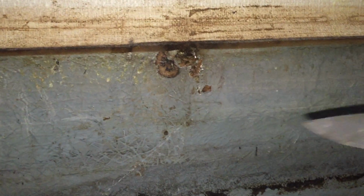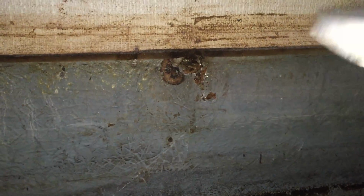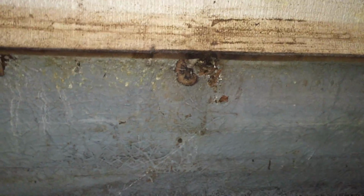right underneath the screw. Hopefully that's going to be limited to small areas. If it's just limited to small areas, we'll dig it out. We'll cut a patch, fill it with a new piece of plywood, wet epoxy it in from the back, set it in there with wet epoxy behind it, and clamp it in. Once we're sure it's well clamped, we'll fill the best we can around that piece of plywood, and then we'll lay new glass over the top. I'm hoping that the engine room bulkhead is not seriously compromised.